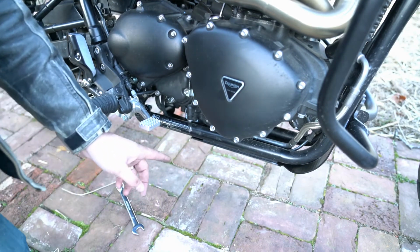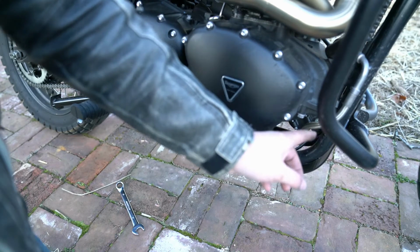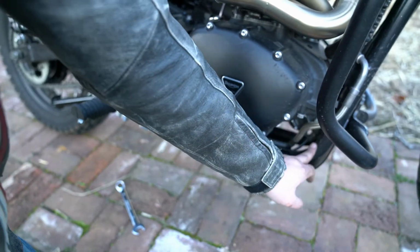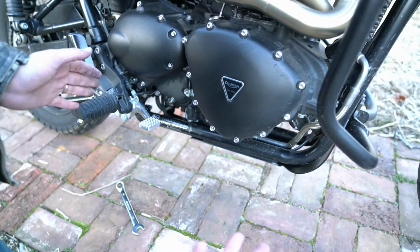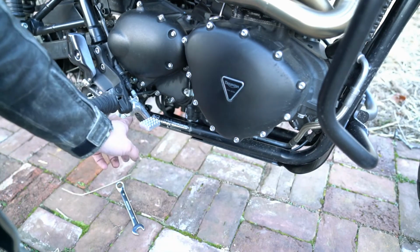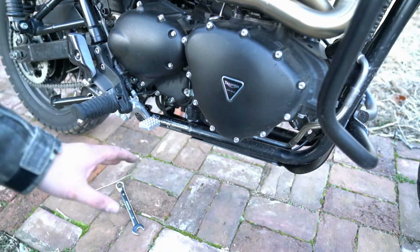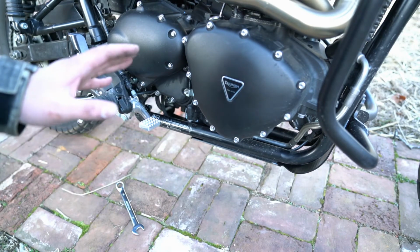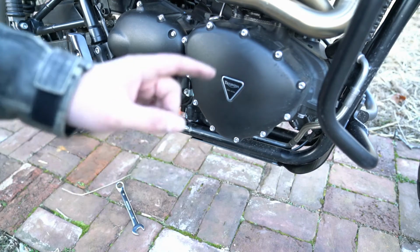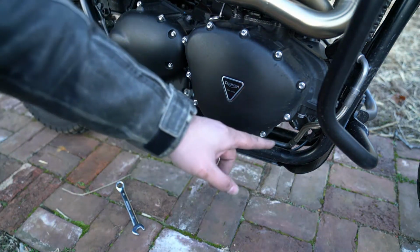In fact, what I've done is, you probably saw I pushed the plate in between the crash bars and the tube on the front of the bike, and then actually slid the whole installation forward to get it to hook onto those bolts in the back. I think that is a bit easier for my particular setup, which really only leaves one thing, and that is to secure the bash plate on the front.